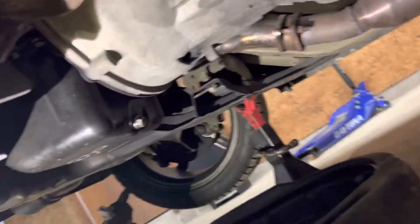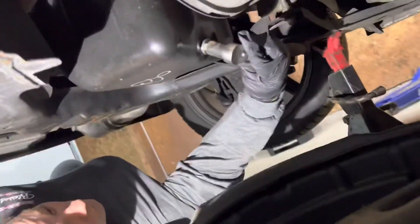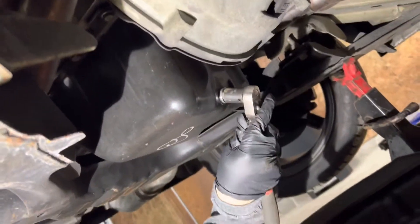First thing you want to do is put it up on jack stands. The second thing you want to do is locate the oil pan and the oil pan drain port. Alright assistant, go right ahead. Using that plug — lefty loosey, righty tighty — it's a 16mm.